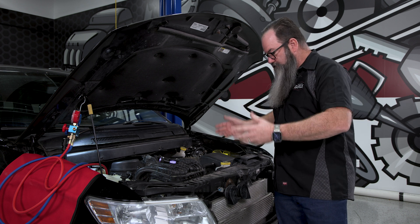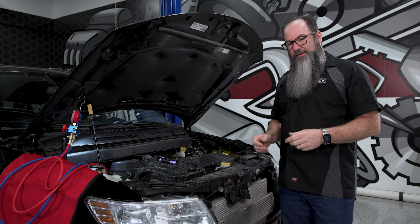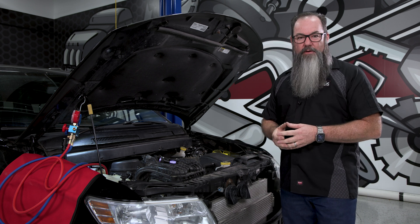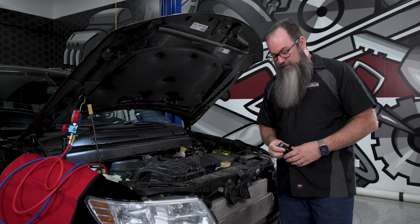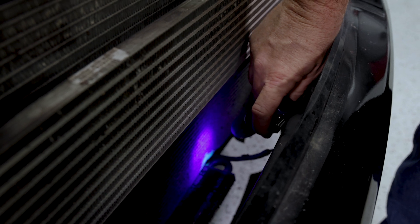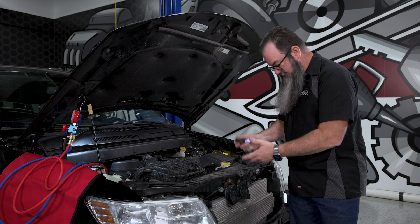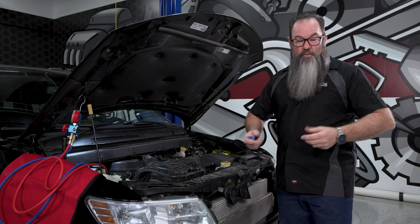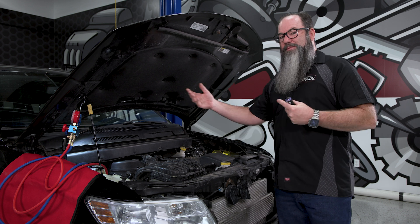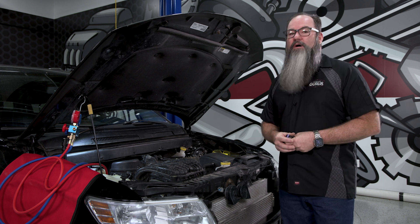So at this point we do a more visual inspection and check the entire system out. I notice there's a little bit of damage down on the bottom of the condenser. We've got the grill removed from this car already so we can see down in there better. I can take my UV light and shine it down where that damage is on that condenser. Sure enough, we can see UV glowing down there in the black light. So now I know this vehicle needs a condenser. With that, I would also do a receiver dryer. It needs new service valves — I wouldn't do just one, I'd replace both of them. At that point, I can feel confident when I recharge the system and give it back to the customer that their problems are resolved.